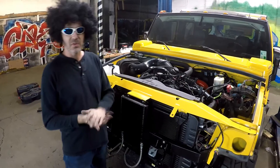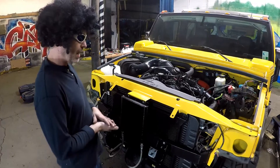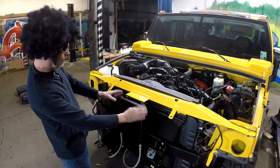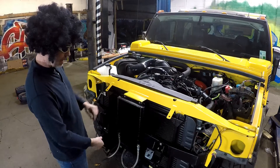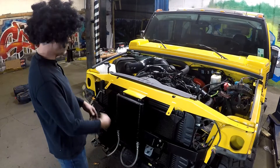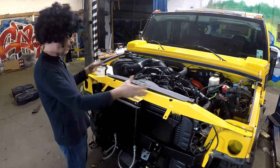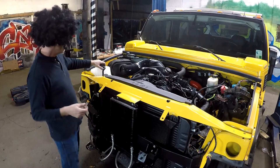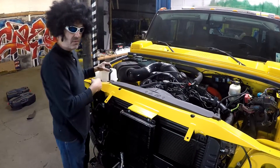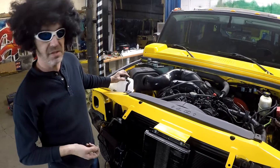At this point you should have your cooling pack and all that stuff in there. You should have your transmission cooler that mounts to the upper and lower tie bar, your Dash 10 stainless lines back to the transmission, your radiator and intercooler pipes on. You should also have your new pressure tank that comes in the kit — it looks like this but it is different, even though it looks identical. It has a plug on the bottom of it — that's a low coolant sensor.